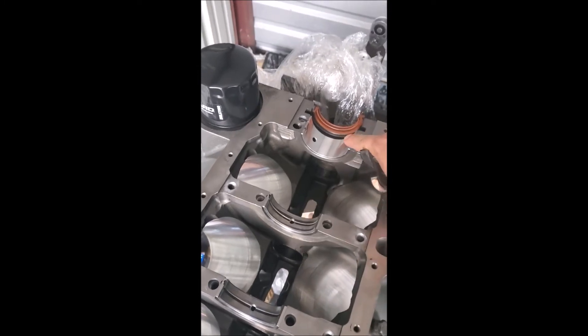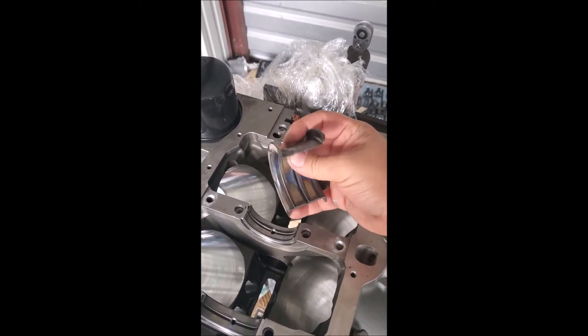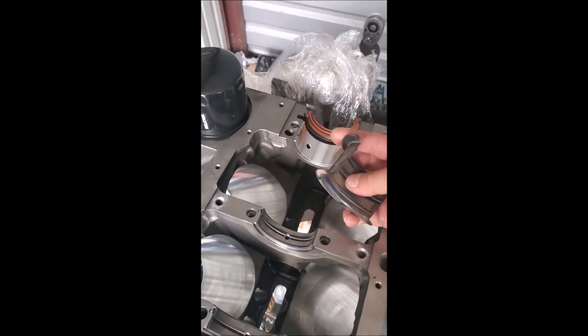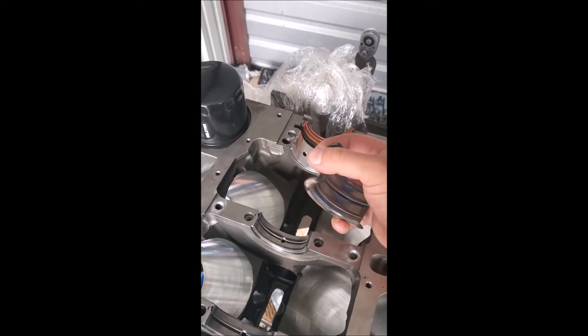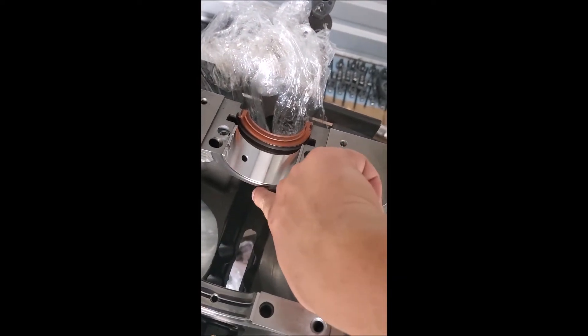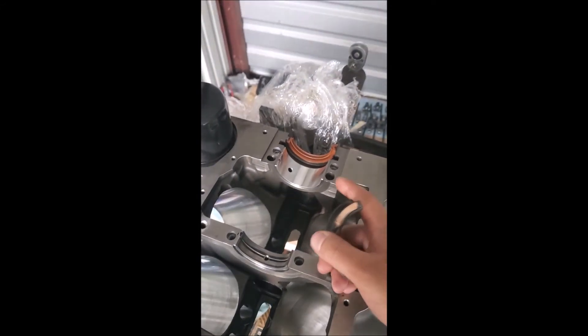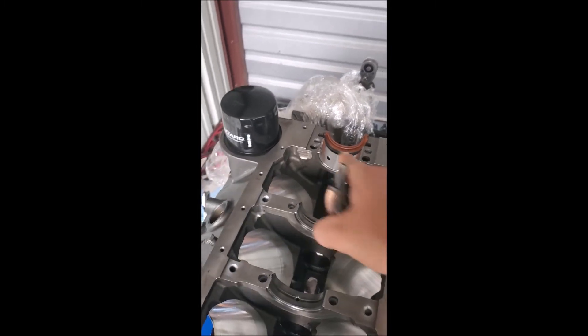I forgot to mention — if you're looking at pictures of these spacers, the rear one, the thrust bearing spacer, you would expect it to look like the thrust bearing with a lip. But it's not. All it's doing is raising up the bore size, so it's just a flat section. It doesn't have the lip that hugs the thrust portion of it.